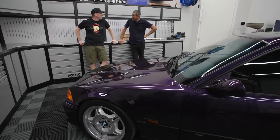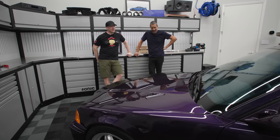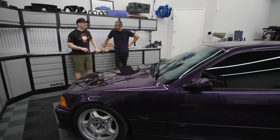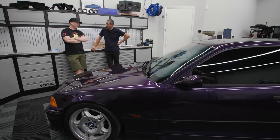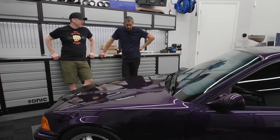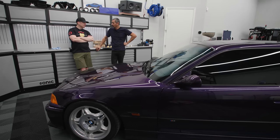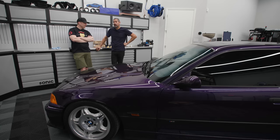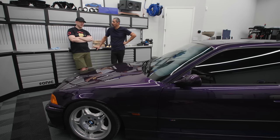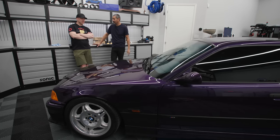The E36 is back on the road. New rack — did we find a new rack to replace the old rack? Yeah, we got all that work done. Thank you for bailing us out. Yeah, that's from our race car, it's just been sitting there collecting parts. This rack is a Z712 yellow tag — it's from a BMW E46, 330, 330i, 330Ci, and the ZHP-packaged E46s. It changes the steering ratio from the stock OEM to the yellow tag — night and day difference.